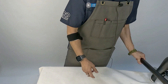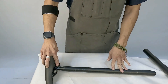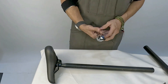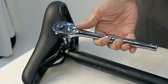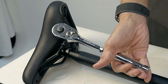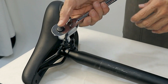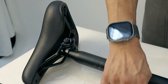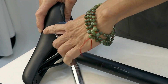For the other type of saddle that we have, this is called a velo clamp. This one, you don't have to get down to 22 Newton meters, but you do have to make sure it is absolutely secure because you can damage it if it's not secure. Keep in mind that these saddles support your body weight — whether that's 100, 200, or 300 pounds — and that is all centered right there. There's a little bit of weight supported by your feet and hands, but most of that body weight is supported here, so you want to make sure that you get these bolts tightened as securely as you can.